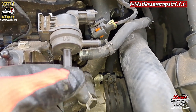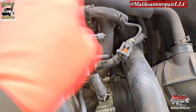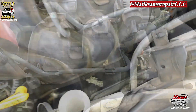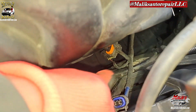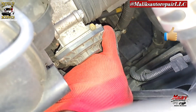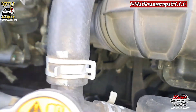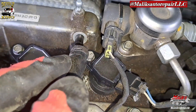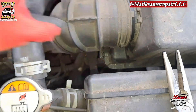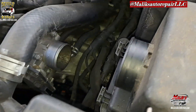And this sensor is the same way — it gets stuck on here. Twist them off first, and then pull them. It's disconnected. See what else we got. So down here we got three wire harnesses. I took all three of those connectors. May as well get that harness out for the throttle body. We're going to go ahead and remove this intake hose — undone, remove it. Line goes here. We're going to take this whole tube out. Got a little more room.